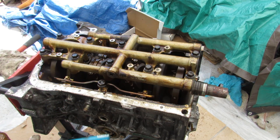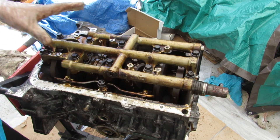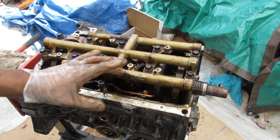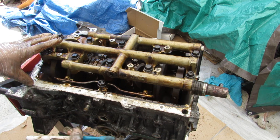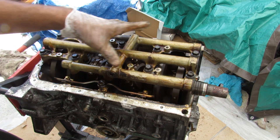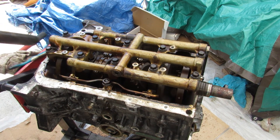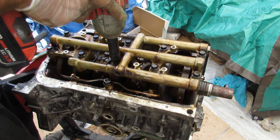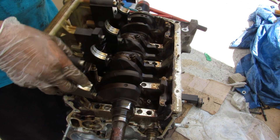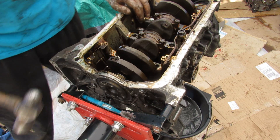Here's a closer look at the rotating balance shaft assembly — most of the weight sits above the centerline to give it its offset balance shaft characteristic. Looking at the bottom end of this engine, you can see what makes it so strong: it's got a ladder frame built up on the bottom. The ladder frame not only reinforces the main bearing bolts that hold the crankshaft together, but also has oil galleys running between them to share oil across different parts of the engine to lubricate each bearing and bring oil from the front to the back of the engine and up to the head. Removing the 14mm main bearing bolts, I can remove the bearing and oil galley assembly. The rear main seal bolts onto the block, so it's always a good idea to remove those bolts and the flywheel before mounting it to an engine stand.